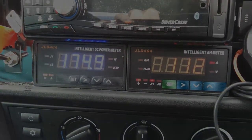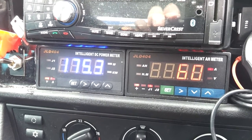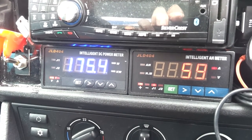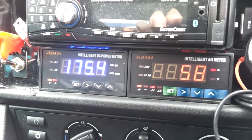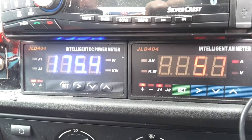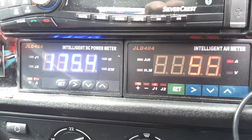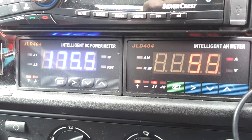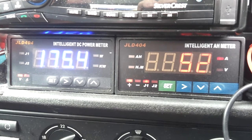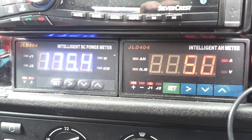We're pretty much at a full battery scenario right now. Current is dropping back very quickly — we're at 60 amps and just over 175 volts. The taper is really beginning to kick in but we're holding voltage very well, not faulting out on any errors as we had during a previous taper current setup. Colin's work on the software has definitely made a big difference here — we're now dropping towards 50 amps.